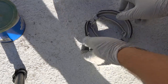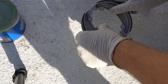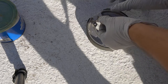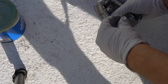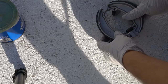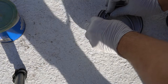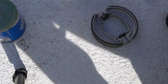Now let's put our focus on the new shoe. We'll get them assembled with the spring — they're symmetrical so there's no wrong way to put them together. Just make sure your rounded side goes to the rounded and the flat to flat, and put our springs on. Those are going to be ready to be installed.